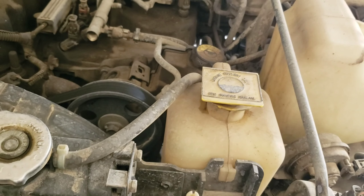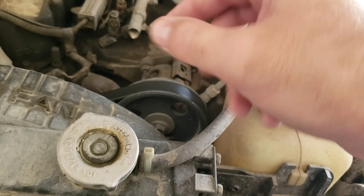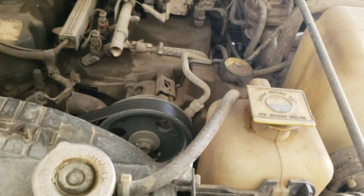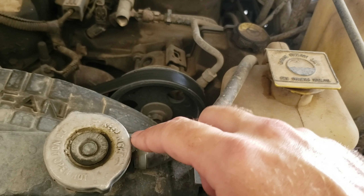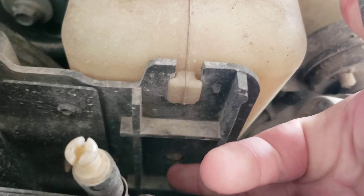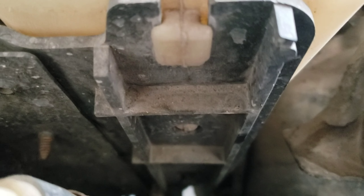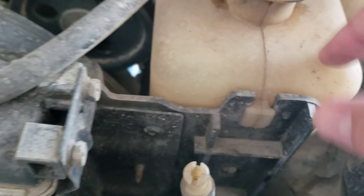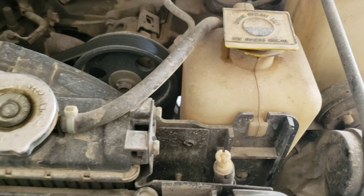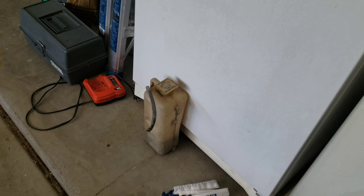Next, I'm going to get my overflow tank off. I have a new radiator, so I'm just going to clip this. You might have a metal bracket or one of those ones that you can pinch with pliers — I just have a zip tie. I'm going to disconnect that. It looks like it just pops right off; there's a little nub right there, so you just have to pop that through. At the bottom, it's another one of these little notches. Go ahead and take your overflow tank off. You'll want to rinse it out and clean it too.